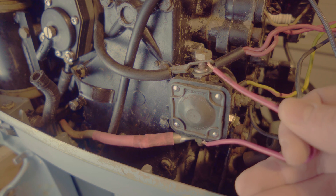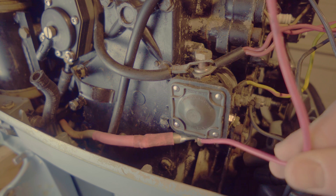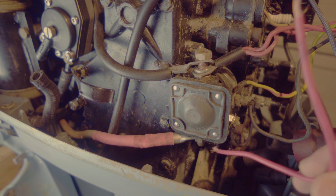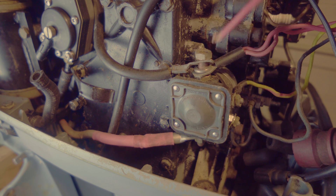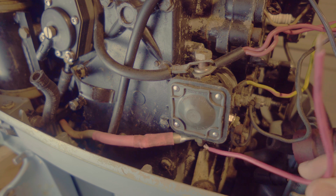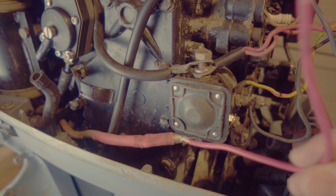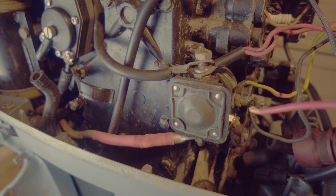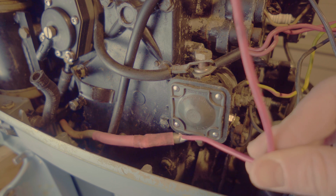This helps you understand what's going on. You could theoretically unscrew the bottom thick cable and touch it to the top terminal, which will engage the starter. Once the motor starts up, you can go and then connect the bottom cable back to the bottom of the solenoid, because there will be no energy sent there — the engine will already have started and the starter will not need power again.